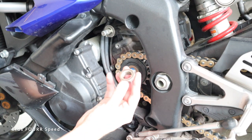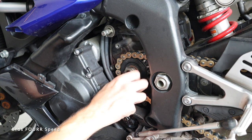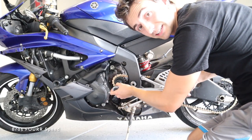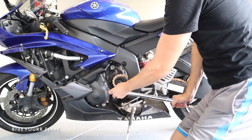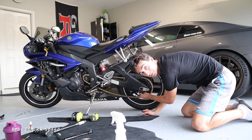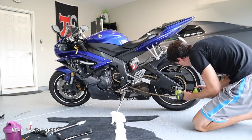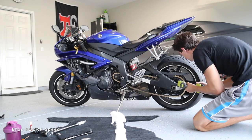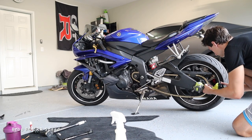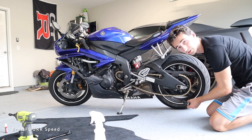So with that done and this bolt all cleaned up, we can get this one on nicely. So it looks like this bolt is supposed to be around 65 pounds of torque. So hopefully with the Loctite, that actually stays tight this time. And now it's the fun part of getting all these ones now back together as I rotate the bike front and backwards to make it work. And then these rear bolts are gonna be about 35 pounds.